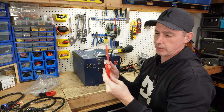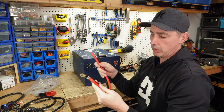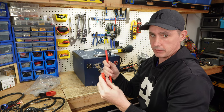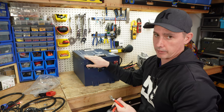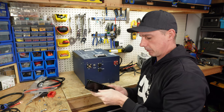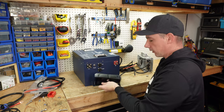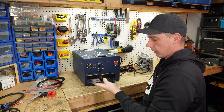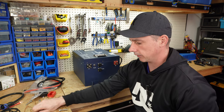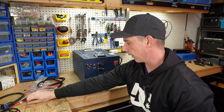We also get another set of cables — these are four-gauge silicone wire. This is so if you want to swap out your existing wiring: normally carts have six-gauge wire, and if you want to beef it up to four-gauge that is ideal, because you're going to get more power out of this than you were with your lead-acid batteries. We also get a couple of brackets for different mounting scenarios. This will bolt to the two mounting points on the bottom of the battery, either to lift it up or come in underneath something for different mounting options. They give all the nuts and bolts, all stainless steel, for the mounting options.